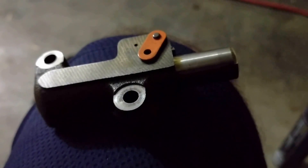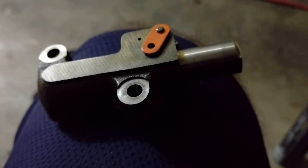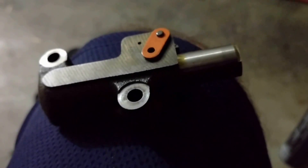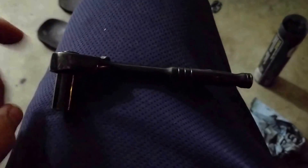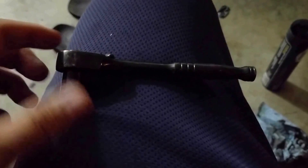It's not super hard. Probably the most tedious thing is getting those bolts off the covering plate — those are 10 millimeter bolts, and they're a little challenging because you have very small space in there. I had to use my quarter-inch socket, the smallest one I have. I'll show you — this is the socket I used, just enough space to crack them loose. After you crack them loose, pull them out by hand. Optionally, use a combination wrench if you're having a hard time.